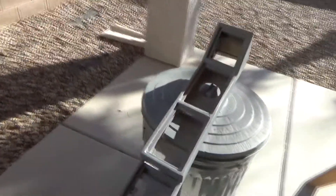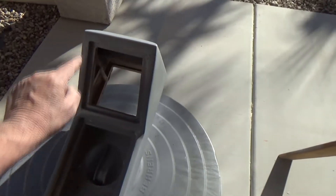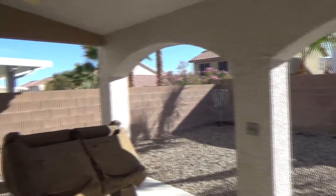The 39 Chevy seat is out here — let it sit and dry. I noticed a spot right here, and all along the top, so I'm just going to lay body filler across it because this is what you're going to see. The sides are good — a little there, but pretty much good. I haven't figured out what to do in here — there's going to be a panel here, panel here, panel here, and a panel here.